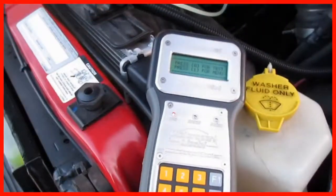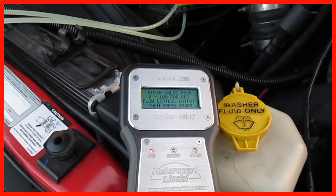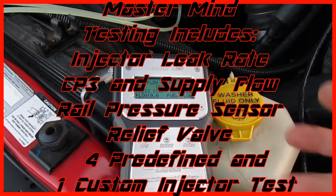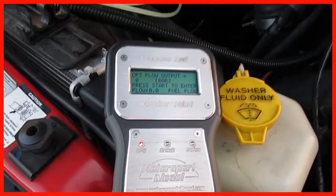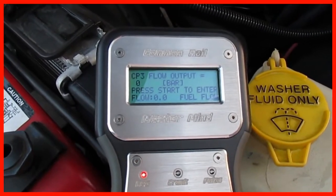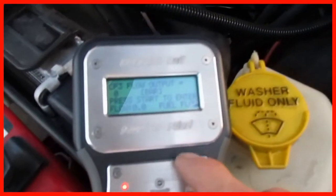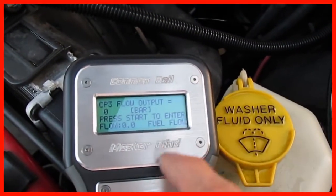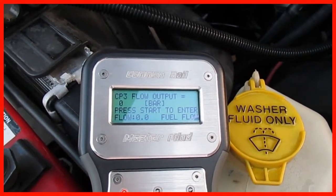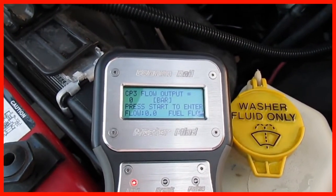By just using the Mastermind here, I'll put it on a test for you — we can enter a value and this will control the idle state of the vehicle. Obviously we can do other tests with this as well. As you can see at the bottom left of the screen it says flow. We've got a flow meter that we can hook up to the output of the CP3, and we can put in different values up here and see how this changes the flow. If we're calling for more pressure and our flow rate keeps increasing, then obviously we've got a problem with our pump — and we've got specifications for that as well.